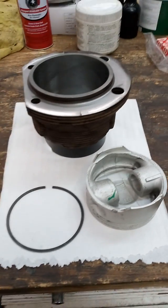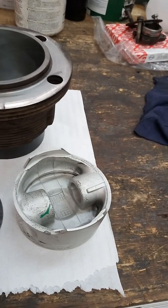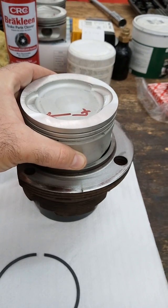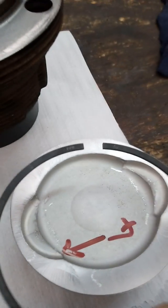The first question usually asked is how do we know which way around the ring fits in the barrel on the piston. The piston sits inside the barrel, so the orientation is currently up. Have a look on your ring — near the gap there's usually writing. The writing is on the side that faces the top of the piston.